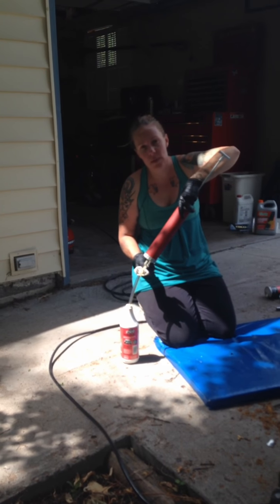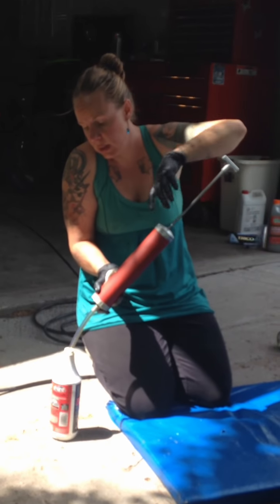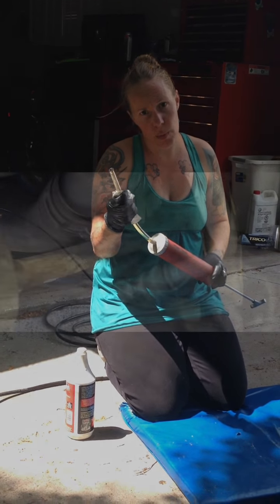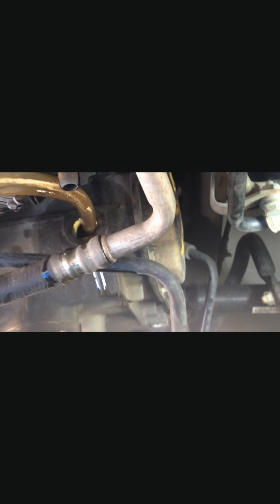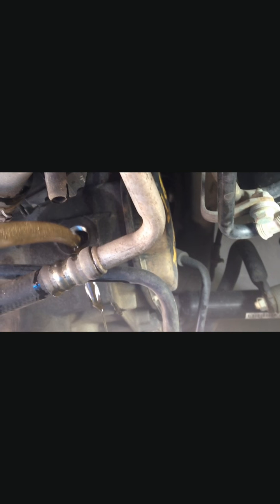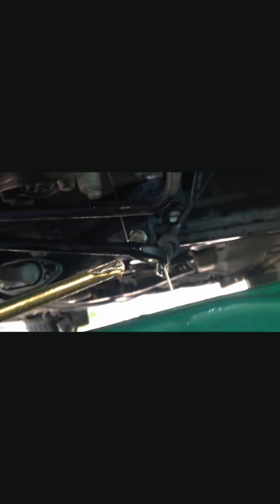This is the tool I use to fill the gear oil. I just suck this up into this tube and put the tube into the fill plug. Then you fill the gear oil through the fill plug until it starts to drip out. Then I put the vehicle flat so I know that the level is correct, pull the plug, and make sure that I've got enough fluid in there.